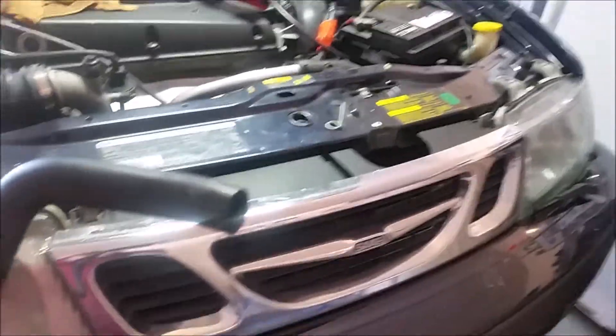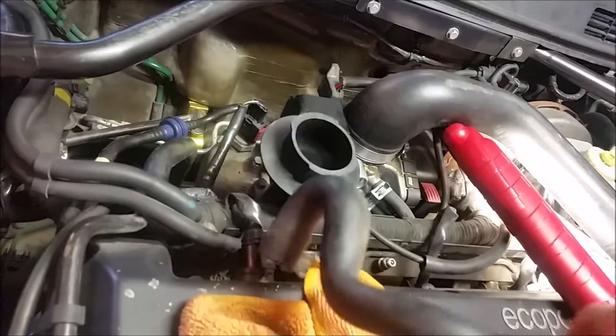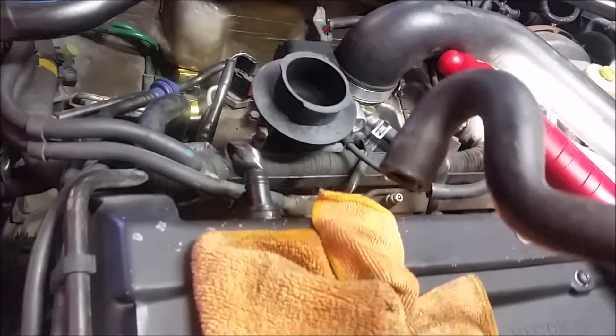I've got to show you this. The first hose that I took off — this end went to the camshaft cover, valve cover if you will. The curved end went to the vapor recovery box. This hose closer to the center line of the car goes to the camshaft cover, and I'm poking my finger in it — that's to the ventilation box.